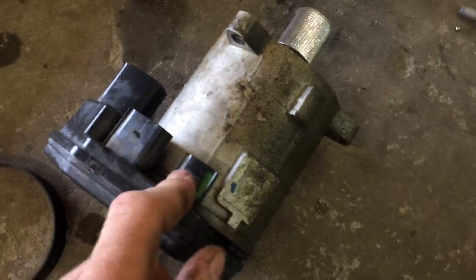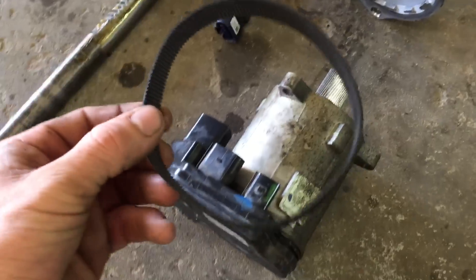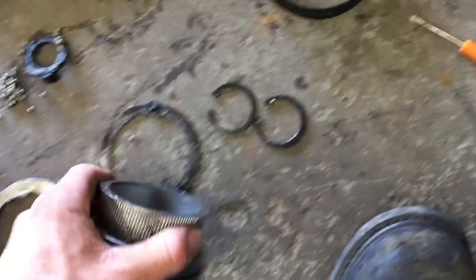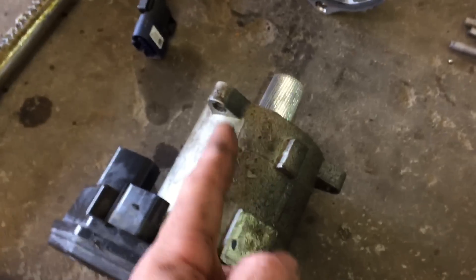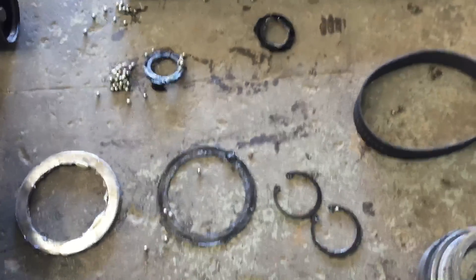This is kind of an interesting design. This is the electric motor which powers the steering gear for power steering assist. It has a belt - this little belt right here - it goes on the shaft, and that belt then connects to this pulley here. As you can see inside, you've got worm gear threads there, and worm gear threads here. When the motor assists, it spins, drives the belt, which then drives this pulley.